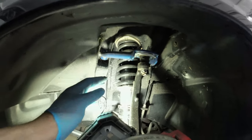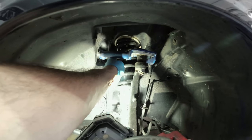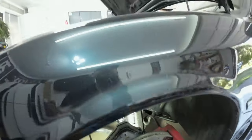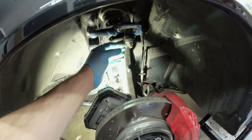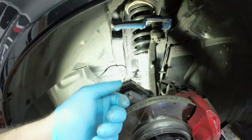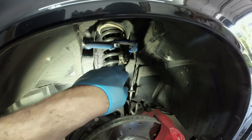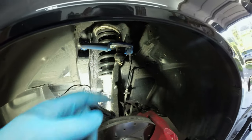It's pretty straightforward, there's really not much to it. Now if you have fat hands or fat tools and really want to get in here to tighten this, it really helps if you remove the coilover from the top mount. The reason why is it allows you to move it out of the way and really torque it down if you don't have a super long 14mm socket like I do. Now that you know how to do that, you're not going to watch me turn wrenches — there are really only about three bolts to loosen and then we'll compare the two once I get it out.